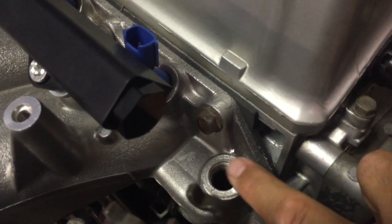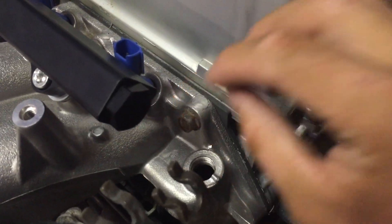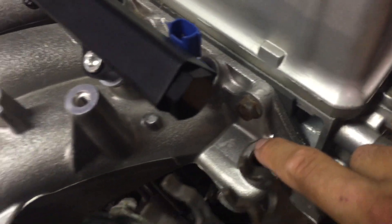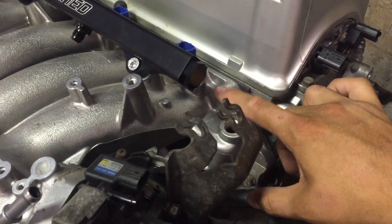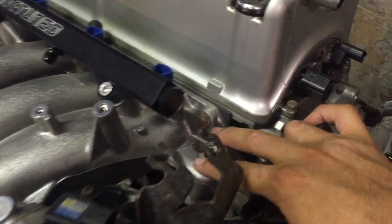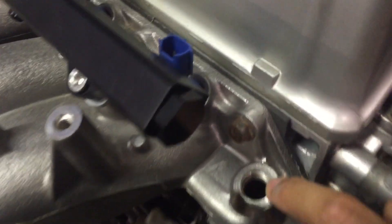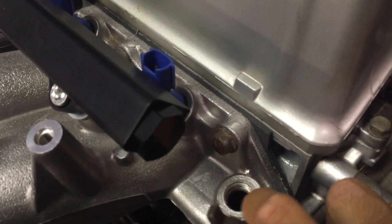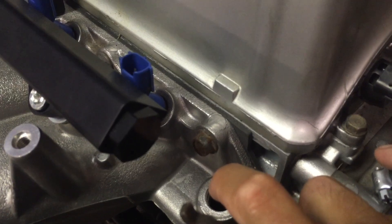There's a water outlet here as well, and this right here was a thermal valve — originally inside the TSX or RSX there's a little hose for quick cooling. I'm just going to block this off with a fitting from a hardware store. I saw on K20A.org someone selling a delete kit which is basically just a plug. Also, K-Tuned and other aftermarket brands sell a plug here where you can put your temperature sensor, and I'll get to that in a bit. The water housing is where the upper radiator hose runs to, and the heater hoses go to the car.